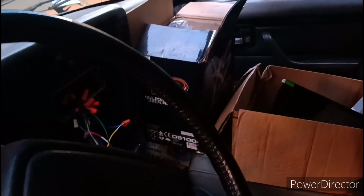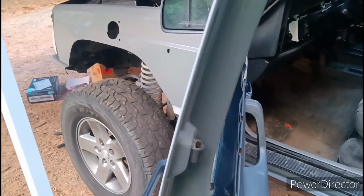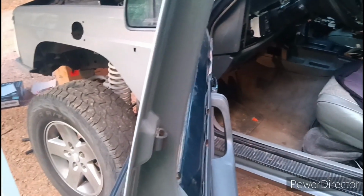But for shits and giggles, let's crank it and let's see how the pulley and the alternator do. I don't hear no weird noises. Oh, it's raining. I feel it. All right, so I don't hear no squeaks. The belt's straight. I don't see it walking or doing nothing crazy. It ain't getting in a bind, making no noises. So that should be good. The mount should be good.